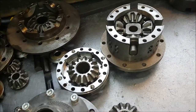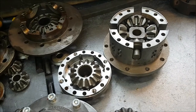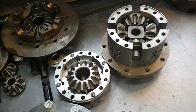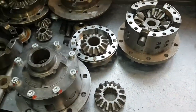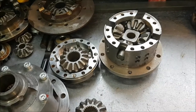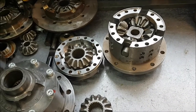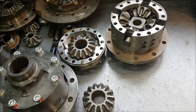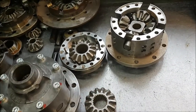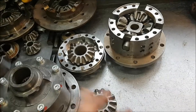And you've got the cam unit. The cam unit, the pros are it's bloody strong. It really is probably one of the strongest out there, especially with this forged cross pin, which is an 18mm. It's got thrust washers. The downside is they are expensive. They are difficult to rebuild. They are expensive to rebuild, and they are absolute pigs to rebuild as well, with all the different shim packs and bits that you've got to put in and make sure that the bits you're using are correct for whatever it is you're building.